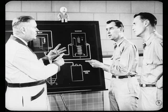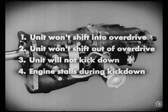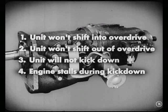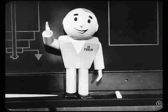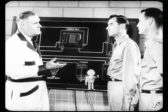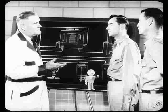What are some of the conditions that can affect the operation of this overdrive unit? Actually there are four conditions you might have to contend with: a unit that won't shift into overdrive, one that won't shift out of overdrive, a unit that will not kick down at speeds above the overdrive cut-in speed, or a condition where the engine stalls during kickdown. Before you start any electrical checks, be sure all connections are clean and tight — a lot of electrical conditions are caused by loose or corroded connections. Generally, if the unit won't go into overdrive, there's an open circuit or a short in the electrical system. And if it won't come out of overdrive, you've probably got a grounded circuit that should be open. A short is actually an unwanted ground, like when a bare wire touches the frame. An open circuit is where the circuit is broken.